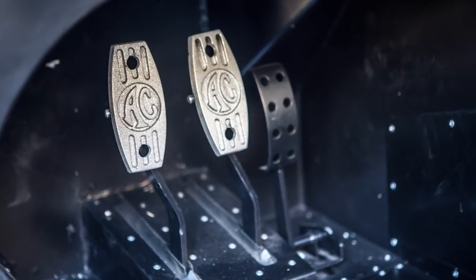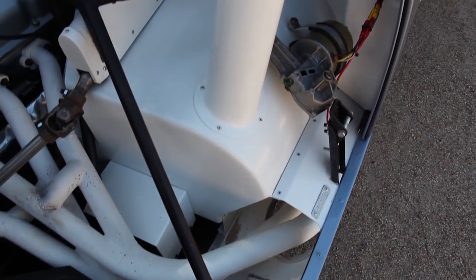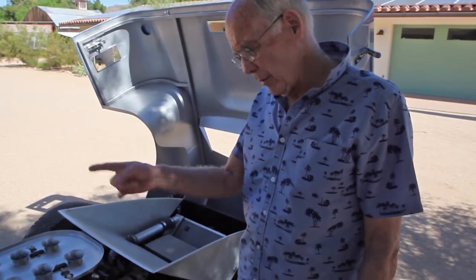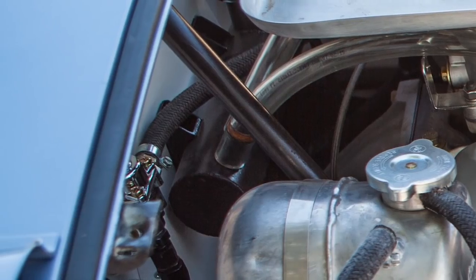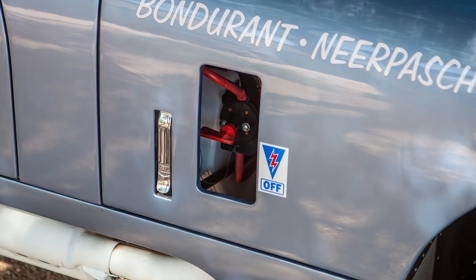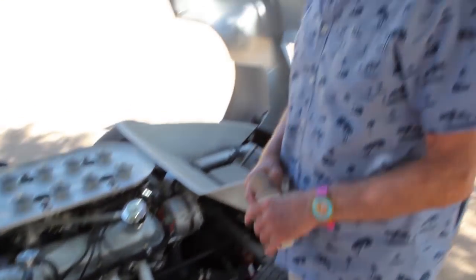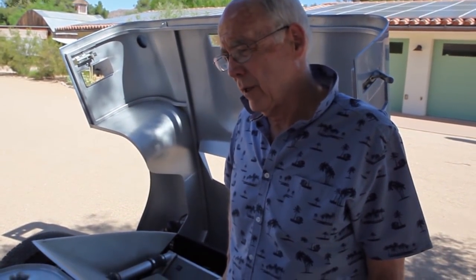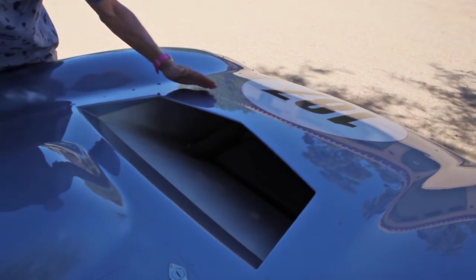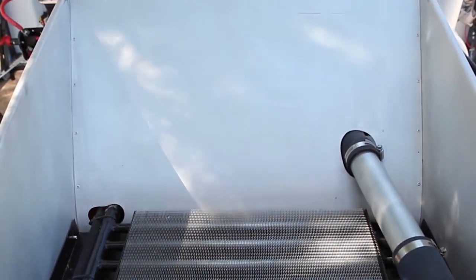The driver's feet can get real hot on those pedals because there's a lot of engine heat and really no insulation — just an aluminum firewall. It's painted white because that does make it a little bit cooler. There's a little bit of modern stuff in here: a fuel pressure regulator and an on-off safety switch required by all racing organizations today, but not many other modifications. In '65 they found that adding a small lip here would create negative pressure and help suck air out of the radiators, but we didn't have that in 1964.